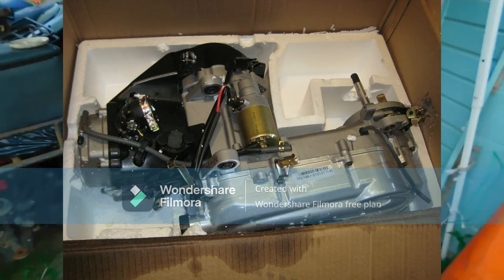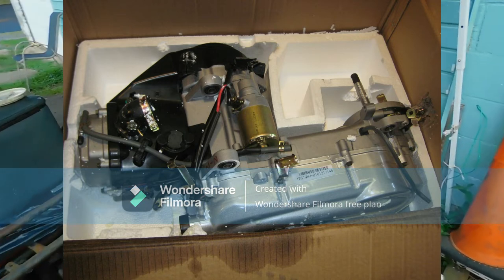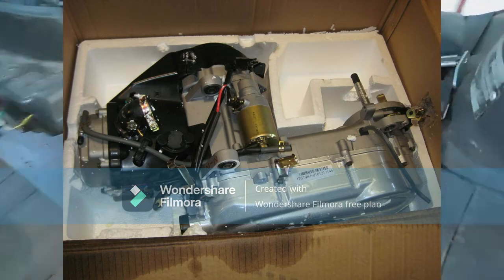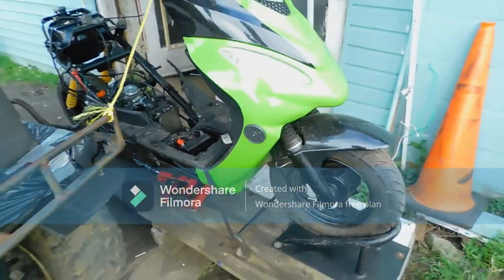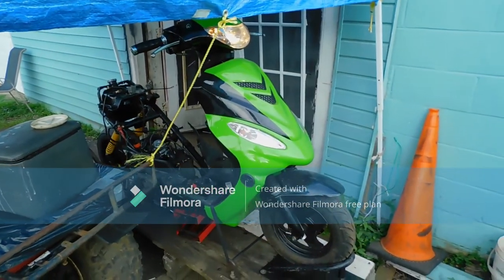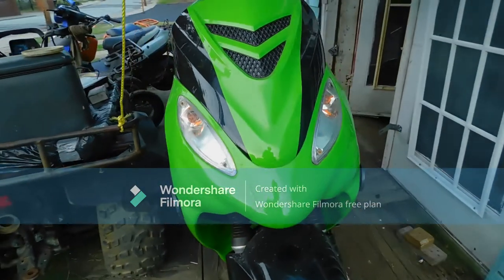This is generally not a direct bolt-on swap, as the most common Chinese scooter engine is bottom mounted on the scooter frame and the most common and reasonably priced GY6 150 cubic centimeters motor is mounted at the top. So here is a roadmap of sorts to help you swap your 50 cubic centimeters motor to a 150 cubic centimeters motor.